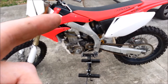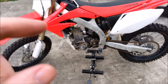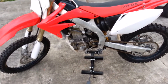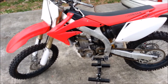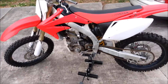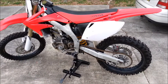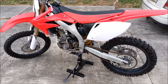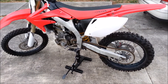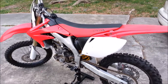Just today I had the tank and everything off, took the valve cover off, and was checking the shims on the valves — they're definitely going to need adjusted. I'm either going to tackle that with some help from friends, or just take it to a shop for a proper valve adjustment. Otherwise the bike ran. He started it up for me and it sounded crisp — not rattly or knocky or anything like that — so I'm pretty confident. Once I get the valves adjusted, I'll know more for sure.